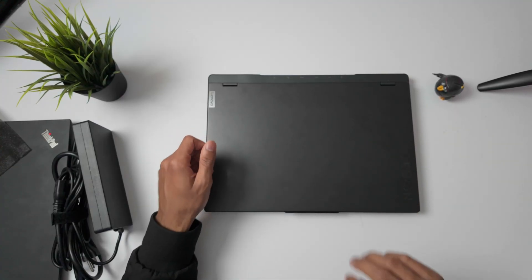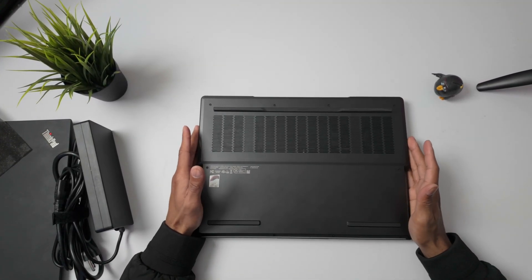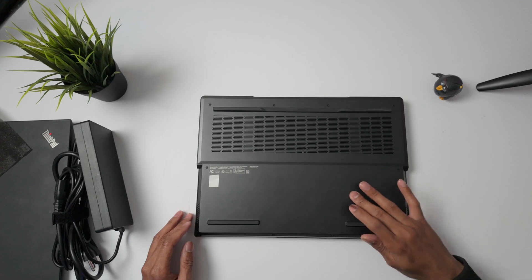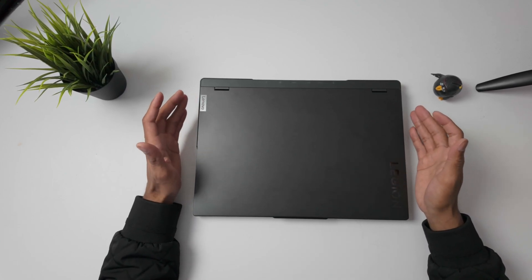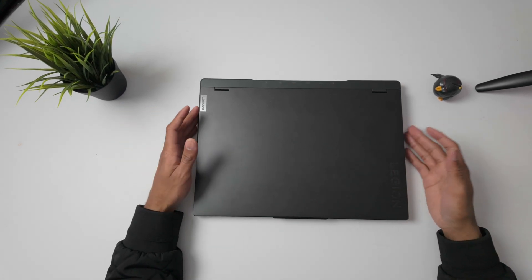What's even nice about this laptop is that it's user-upgradeable. If we pop off the bottom plate, you'll find that you can upgrade the storage, the RAM, and the Wi-Fi card. So you don't have to buy it with the max specifications like some laptops where what you buy is what you get because it's soldered onto the motherboard. In this case, you can get it with 16 gigs of RAM and upgrade to 64 or 32 if you want. Just knowing that's an option is pretty nice, and one of the reasons that drew me to purchasing this laptop at the price point that I did.